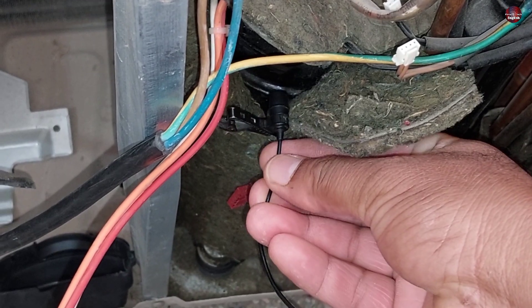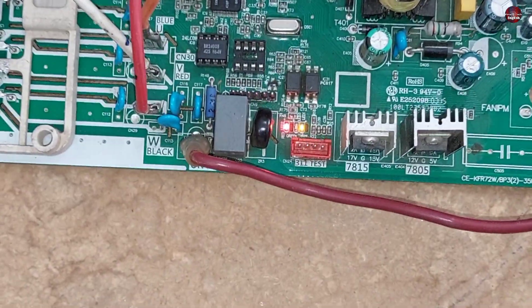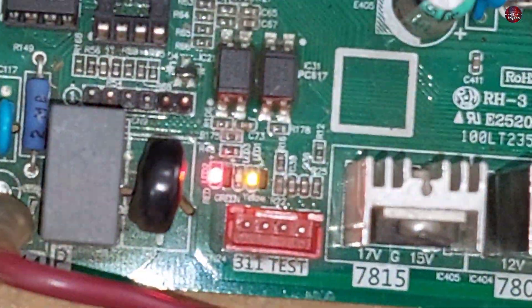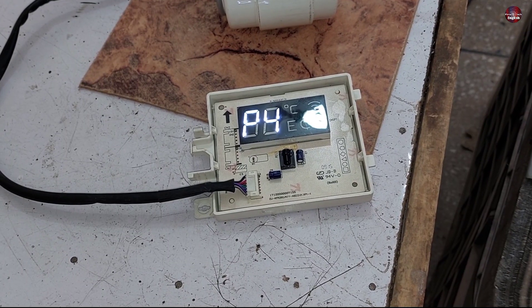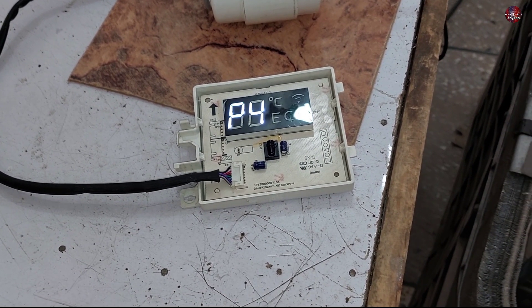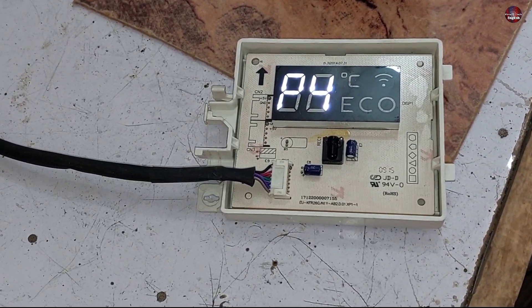It has started the compressor. As you can hear, the compressor's sound seems strange. The red light has started to glow and the green light has stopped glowing, and the light is repeatedly cycling in this manner. Now you can see it has started to show a P4 error on the display. So it is showing different problems in different situations.